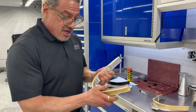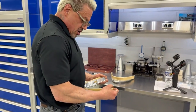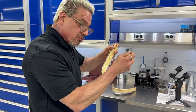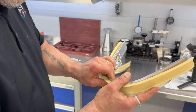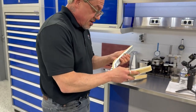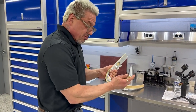It's the attachment method that we changed. Notice — no candy-ass clips here. What we have instead are three lugs: one, two, three. The genius here that our lead designer came up with was: we don't need thick clips. We'll make the U-shaped guide — the plastic portion itself — be the clip, by manufacturing it so that it has to be pulled apart in order to be inserted. It goes on the bottom and won't go in unless it clips in itself. This thing is self-attaching, and there's no way for it to rotate because these lugs go into corresponding holes in the U-shaped billet back, preventing it from rotating.